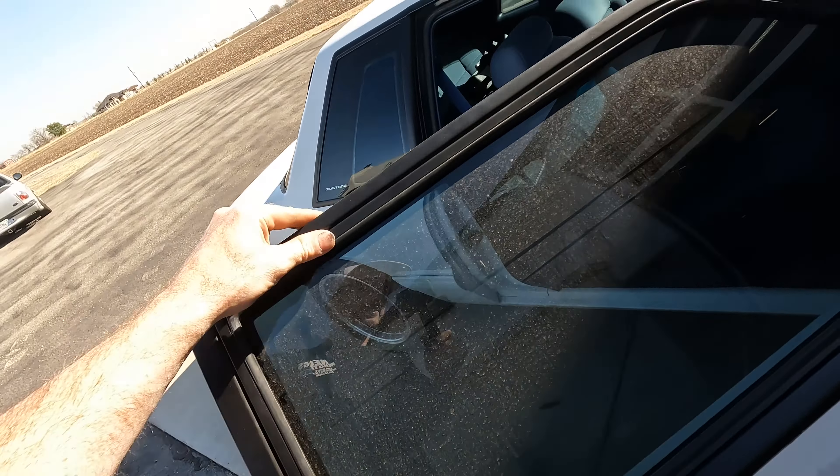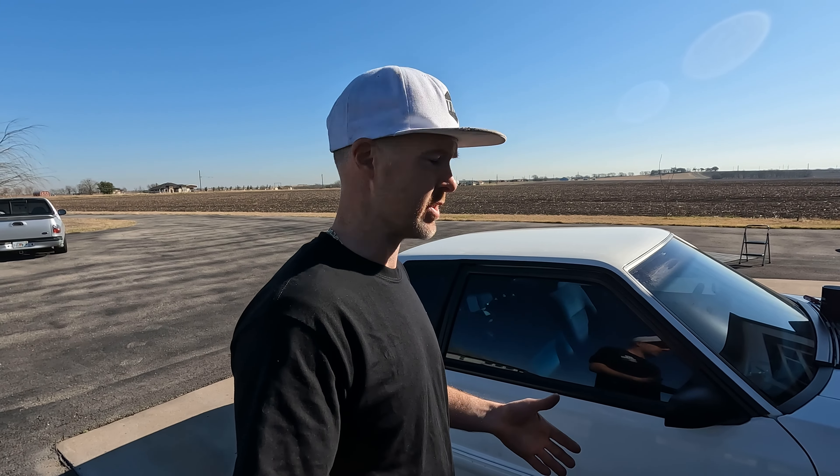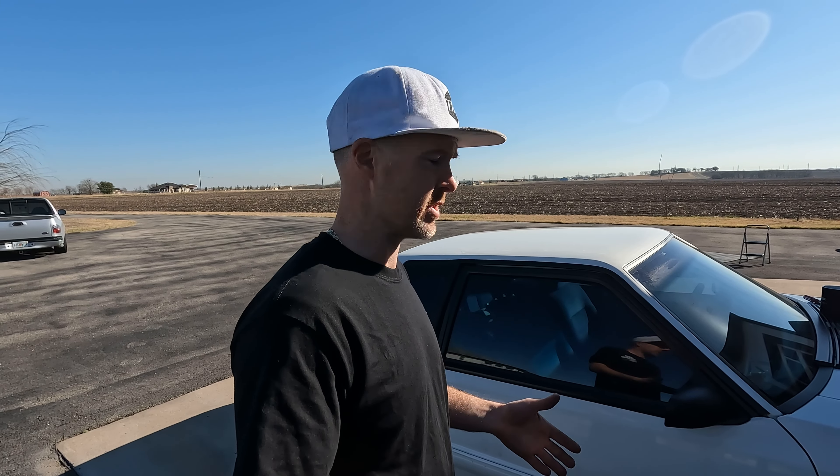There you go — that really wasn't that bad. The brand of these window channel runs are nice and easy to work with. Didn't have to lubricate them, didn't have to hammer material in to get them to seat — they all went into place nicely. Took me about 15 minutes per side, mind you the door panels were already removed. Add another 30 minutes for that and you should be able to get this done. If it's your first time, call it two hours, maybe two and a half. If you've done it before and taken door panels off a Fox body or similar, you can knock this out in under an hour. Hopefully this video helped you guys out a little. I'm going to grab my coffee mug and take a little break and celebrate project 'Come and Take It.'